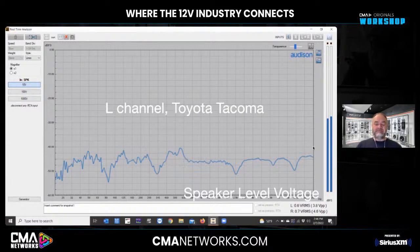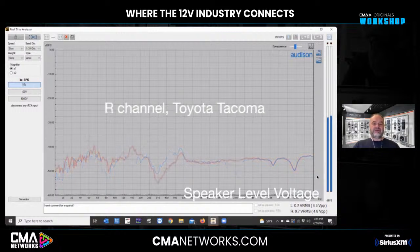And you can see on the left channel, there is a lot of equalization applied to this signal. And in this particular example, there is also some bass roll-off. At lower volume settings, there's actually a stronger bass, but we're just going to look at it at this one volume setting for a moment. And you can see in the lower right, the voltage is higher than it was. We're at roughly 4 volts of peak-to-peak output, and we're not clipping because we switched to speaker. So now I'm going to switch to the right channel. And you can see it's similar in voltage.